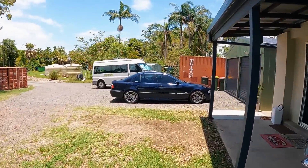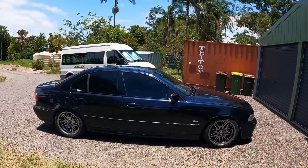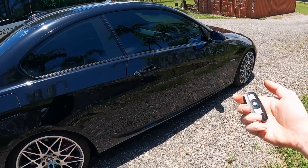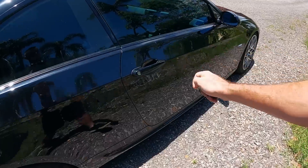The E39 has been out this morning doing logs — it's on Haas' custom tune from HTE at the moment. Unfortunately we're getting mega timing corrections. We were on the ESS map, but it looks like it's going to need some sort of intake cooling, because this morning when we were doing the logs at around 6:30–7:00 AM — obviously nice and cool — we were still getting super high intake temps, like into the fifties pretty quickly. Will the key work? It did. Thank God.